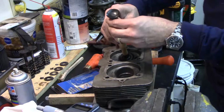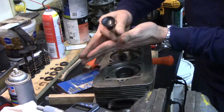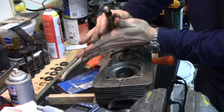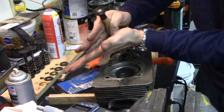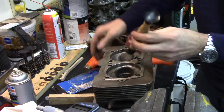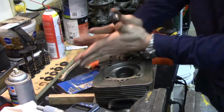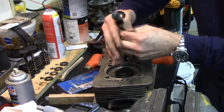We're using the stick, and it doesn't stick very well. The suction cup on the end, it's kind of like you're starting a fire with it. So this valve lapping compound has a little bit of aggregate in it. It's silicone carbide, something like that. Stuff they make sandpaper out of. And some grease or something to carry it in. Put it on that seat.